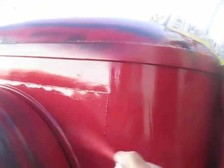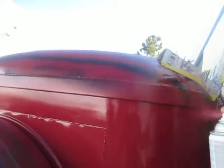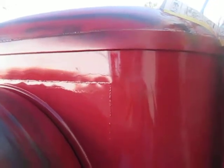We just paint right over the welds and right over the dents and everything else, because in the end it's all going to get sanded down or media blasted. Media blasting is a kind of sandblasting — they use plastic pellets, it's easy on sheet metal and gets everything spotless clean. Then we're just going to take a grinder, a hammer and dolly, a slap file and torch, and start shrinking and working the metal.